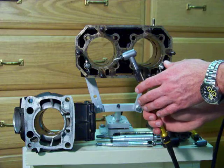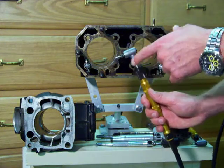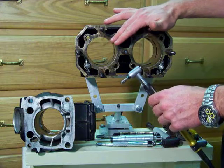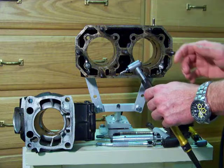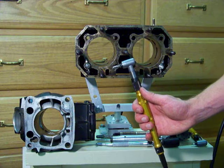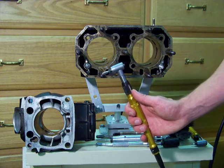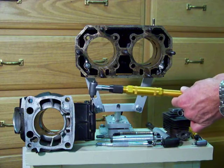As you increase speed, you increase the heat at the contact point. If you're using air grinders, you can actually be heating up the aluminum, which will cause it to ripple, distort, and change the actual metallurgy of the aluminum. So you're actually fighting against yourself when you heat it with an air grinder, because you have to run at such a high RPM. Ours has the same torque and strength at low RPM as it does all the way up to 15,000 or 20,000 RPM, which is an important feature.